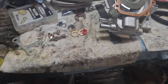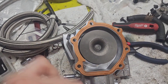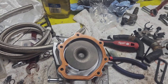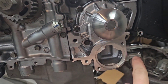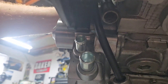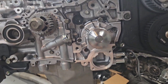I always use a little bit of copper spray on these gaskets, always use a metal gasket. It just helps it be a little bit tacky and fill in any small imperfections or tiny gaps. I don't want any leaks on this thing. On a more thrashed motor I might use a light film of RTV, but since everything is brand new I'll do it this way. Torque these to nine foot-pounds in a star pattern so everything seals nice and evenly. Then we need to put our coolant hoses on — thermostat and all that will be last.